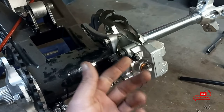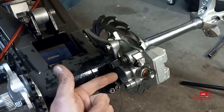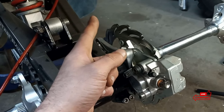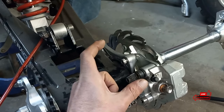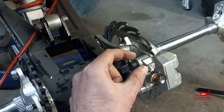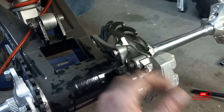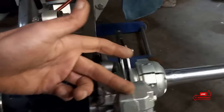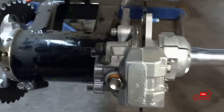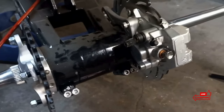You're going to get a lot of heat from all the friction. You could possibly overheat and ruin the seals that go around the piston that's inside the caliper — that's what makes your quad stop. When you press on the brake pedal, it introduces pressure to the brake fluid system. Brake fluid does not compress, so it pushes the piston which squeezes the brake pads together. If you're down to the metal and getting way too much heat, you'll warp your rotor, have no effective brakes, and cost yourself more money in the long run.